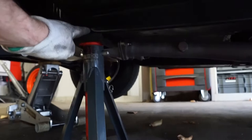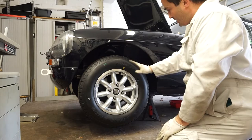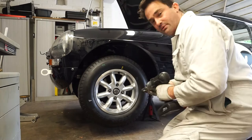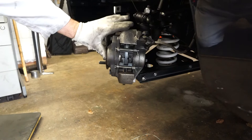You'll be able to see here where I've put the axle stand — I just get it on that chassis rail so it's a nice firm point to rest the car on. We'll do the same on the other side and then move the jack out of the way. The car is now on axle stands both sides and well supported, so we can remove the wheels. I didn't need to undo the wheel nuts first because I've got a gun to take them off with, and with the wheel out of the way we can now access the brake caliper.